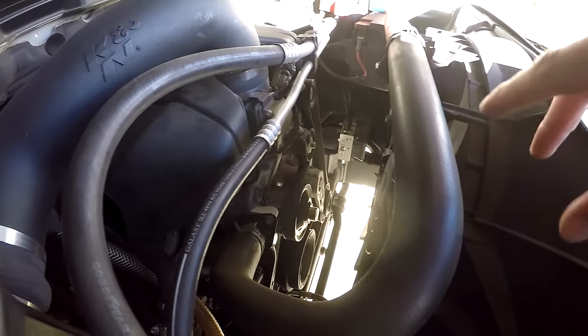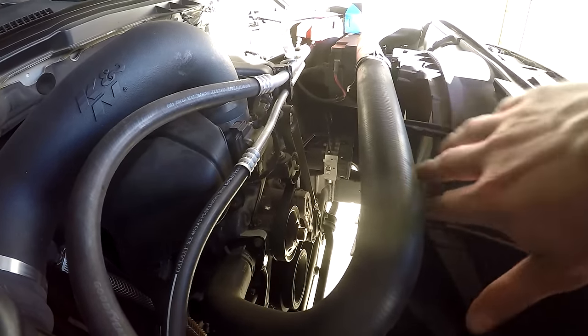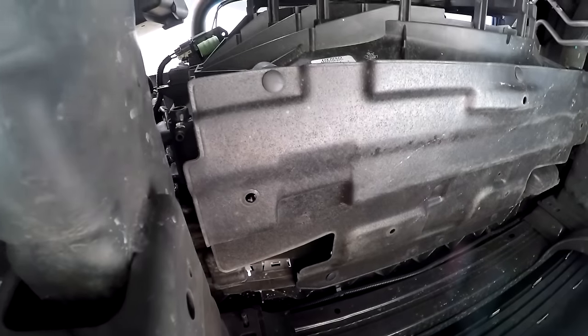If you look inside you can see '180 degree' on that copper piece. On my truck, because I have the fan mod — which removes the stock fan shroud — here's where the thermostat is. You've got two 13mm bolts and this pops right off.